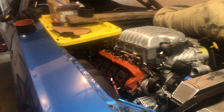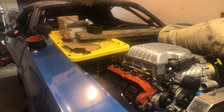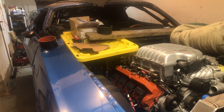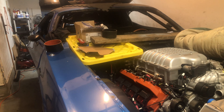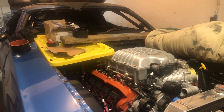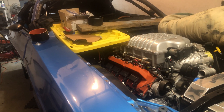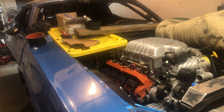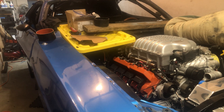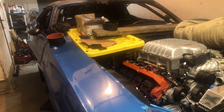You either need a two-piece driveshaft or a slip shaft to take up pinion movement, since these don't have a slip yoke at the front. They use a Sinax hub, which moves the U-joint back a bit, putting more leverage on the output shaft. I'm still debating whether to keep the 8HP90 - all the grenading transmissions seem to fail down-track at high speeds, which points to critical speed, but it's hard to believe so many driveshaft shops all made the same basic mistake.